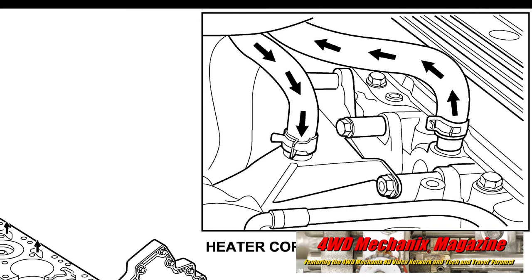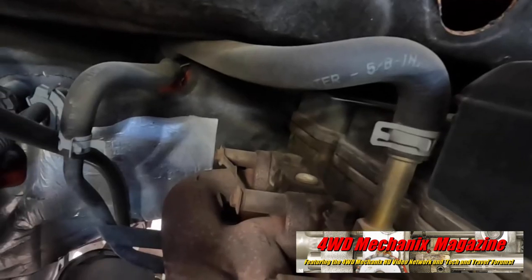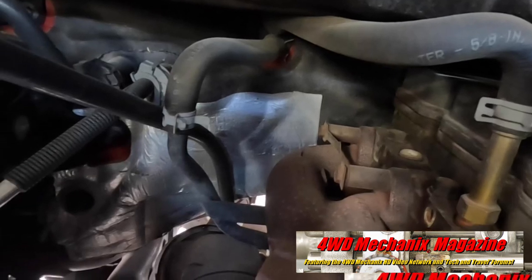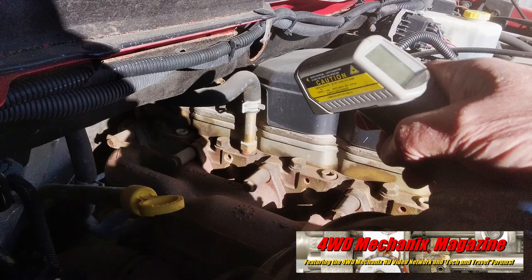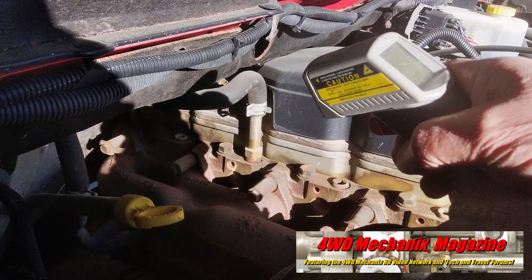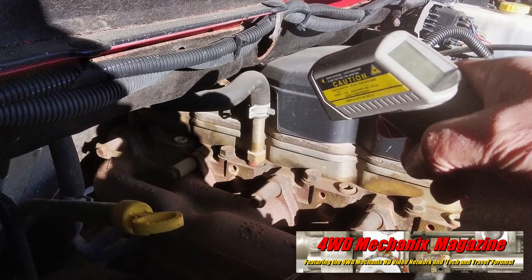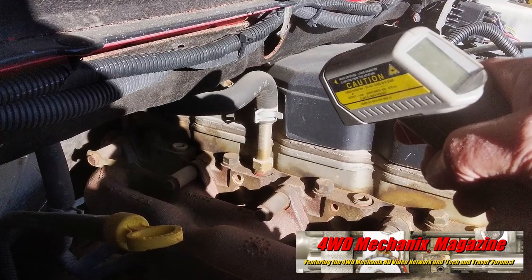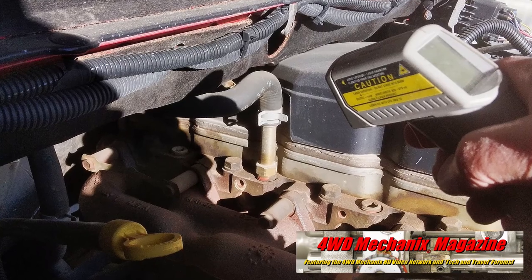When the blower fan pulls air through the heater core, the core cools some. Reducing the heater fan speed should raise the outlet tube temperature closer to the inlet temperature. If the engine is running at normal operating temperature and coolant is not hot at the outlet side of the heater core, the core is clogged. Heat is directed into the cabin by the HVAC airflow blend doors.